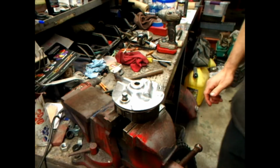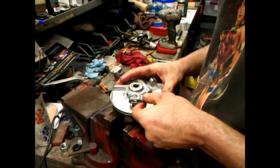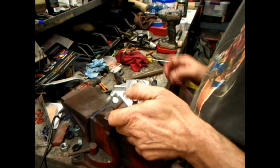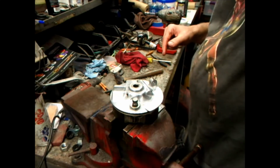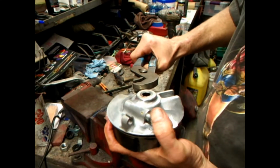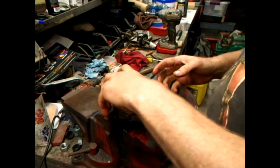Get the brake arm on. And sometimes you have to have it all together. That way you can clock this arm. You got your little recess part cut out. That's going to go towards your axle bolt. There's a dot. Well, evidently I got the dot 180 out. Let me see if I can't flip it around. So the dot's going to go to the outside. What it's going to do, it's going to spread the brakes out, and they're going to come back together. So whoop-de-doo, I say.